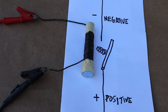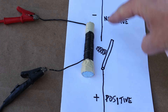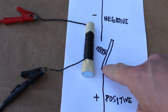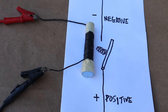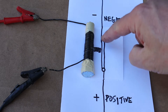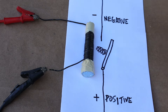Now that we know we can use Faraday's Law to make an electromagnet, here's how a relay works. A little bit of electricity comes in, wraps on a coil, makes a magnetic field. Then we've got our larger amperage electricity circuit we want to power, with two terminals coming out. Inside there's a little spring that normally holds a metal contact away — an open circuit so electricity does not go through. As soon as we flip the switch with power on, we've made our electromagnet, there's enough magnetism to pull that little metal contact down, connecting the circuit and allowing electricity to flow to the larger amperage circuit. As soon as you kill the power, the spring pushes the contact off and we break that circuit.